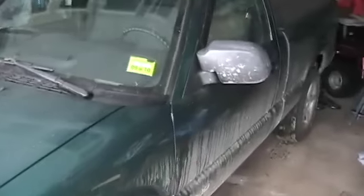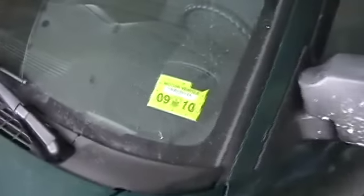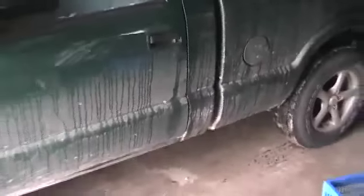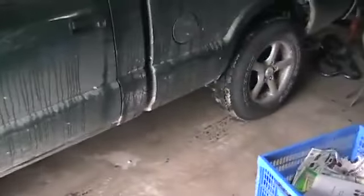Hi folks, it's Ben and I'm here with my 1999 salt-covered Chevy S10. A little bit earlier I did get an inspection sticker and I did have to replace a couple steering components. But since then I've developed a minor vibration between 25 and 35 miles per hour. If you don't have mud and snow packed in your wheels, then probably what's happening is I've got a bad u-joint on the drive shaft.